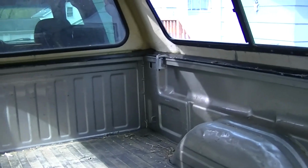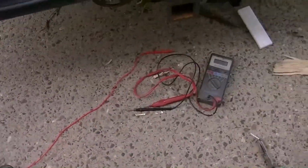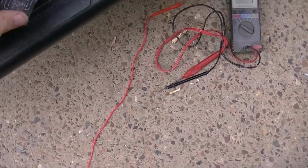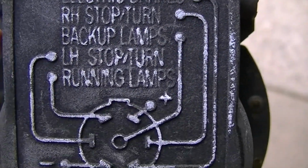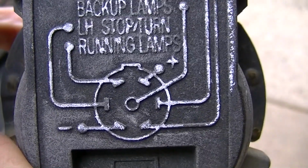And I was having a heck of a time finding a place to light them. Well, I figured, I'll go with the 7-way. I'll pick off the power from the 7-way and then run up. But I got the multimeter out, and I'm finding that I only have 7 volts back there on the pin. From the positive there to the negative, you're supposed to have 12 volts. I was only getting 7 volts.